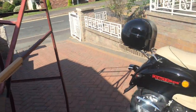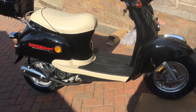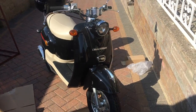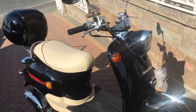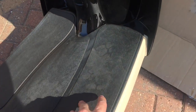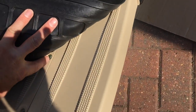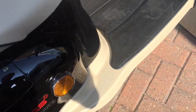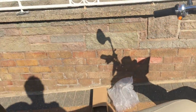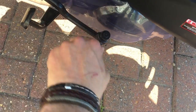We're pretty much set up — you can see all the packaging there; the scrap man's going to love this. This is the 50cc retro Direct Bikes scooter, the DB50QT — a very attractive looking machine. I haven't started it yet, so you need to get some petrol and check the oil first. Make sure the battery screw is in to hold it on. It's an auto choke, however there is a kickstarter here if needed — it flies out in traditional style.